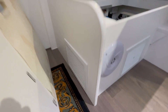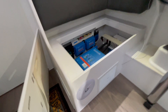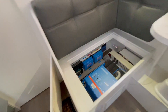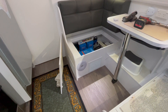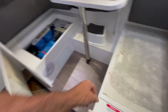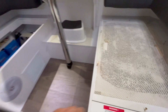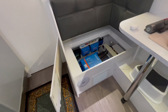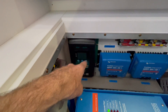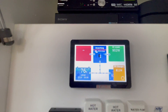Look at all the venting — big vents. You try and keep this area nice and cool. External vent out there as well — you can see the light through this. It's going to be drawing in a fair amount of cool air to keep things going. 8 kilowatt hours, guys. There's 620 amp hours of lithium under there — 620 amp hours of PowerPlus Scouts. All the Victron equipment on this — it's an absolute beast. We had the vehicle running and we were getting 48 amps — 48.5 to be exact — as well as the solar, so we were seeing some really good numbers.